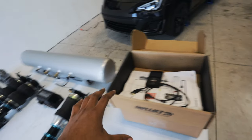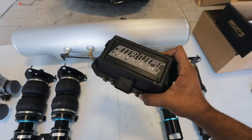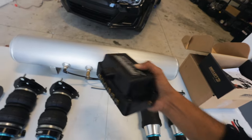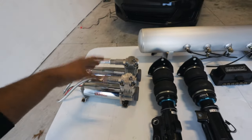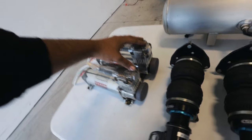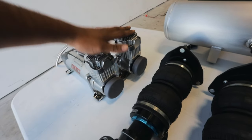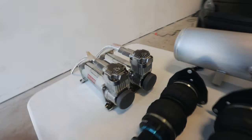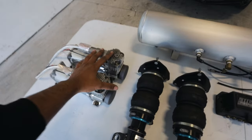The management is super important because it is the brains behind the entire air suspension setup. This right here is the Airlift 3P manifold — all the air comes in and out of here and this controls everything. With the management you also need air compressors to pump air into the tank. When it comes to compressors, you choose how many you want. We're going with two. I feel more comfortable with two compressors because if one goes out, you still have the other one to save the day.